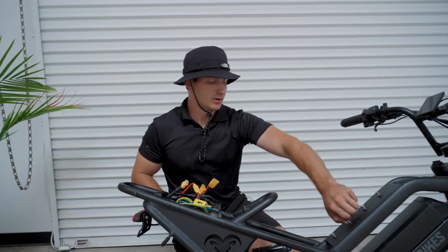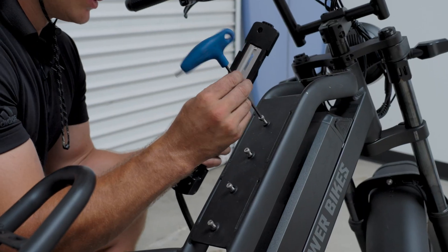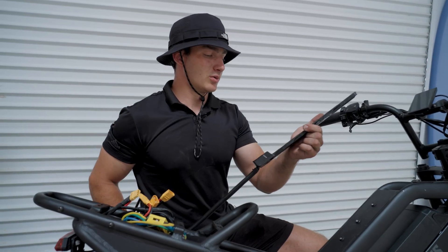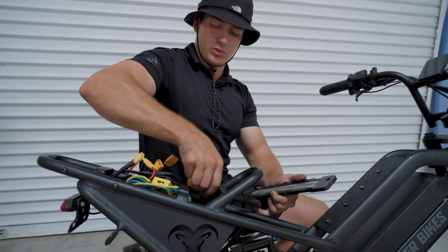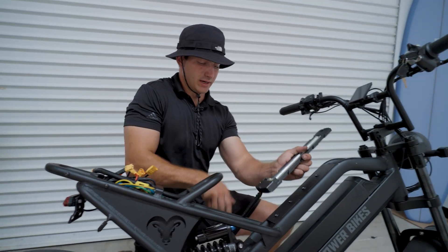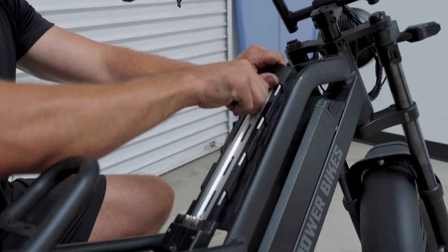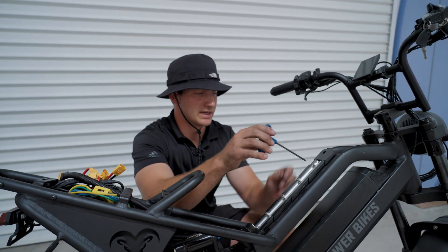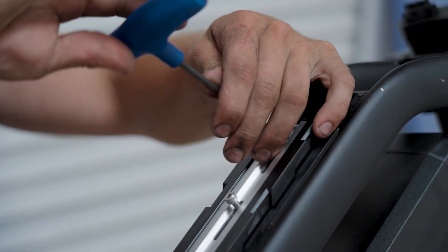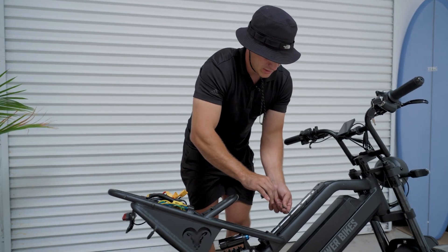Let's go ahead and install the battery plate first, then we'll reinstall the battery. We have our battery plate here — these are 4-millimeter allen key bolts, so we're just going to remove these. Now that we have the bolts uninstalled, we can go ahead and install the plate. Just take our plug here, guide it up through where all the other plugs are so it's nice and neat, then set the battery plate down and thread in these bolts by hand first so that we do not cross-thread them. Once you have them all tightened by hand, take your 4-millimeter allen wrench and just tighten them down.